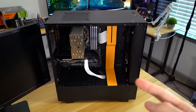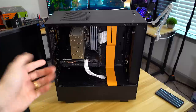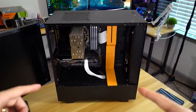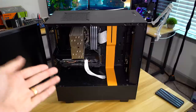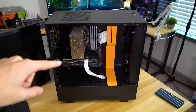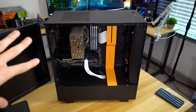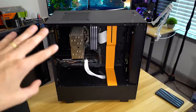So what I'm gonna do is plug in some fans and just let them hang so that we can install Windows on this machine, because I don't want it to crap out on me in the middle of the installation. That would be pretty bad. So I'm just to be safe gonna do that. Of course, I can't manually downclock the graphics card without booting into Windows first, so I have to install the OS beforehand. The CPU though, I'm going to go ahead and clock down to probably, I don't know how long I can go with this board, around 2.5 gigahertz or so across all cores, and really undervolt this thing just to keep temps in check while we install the operating system.